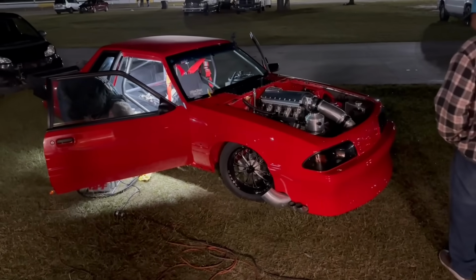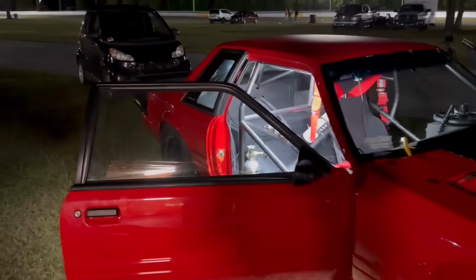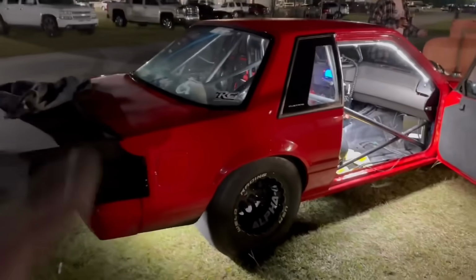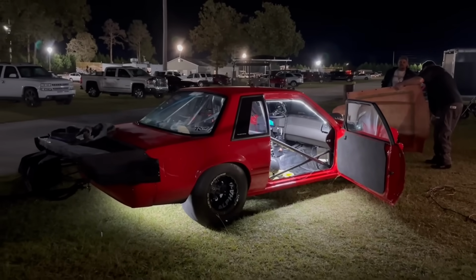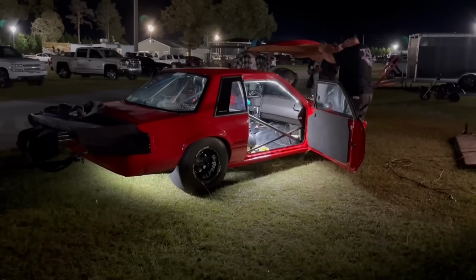All right, guys. Well, we just made our first lick, and that thing went pretty straight, went good. Uncle Mike did a great job on the rear end. Now, something we are not able to monitor at the moment, we don't know how fast it's separating in the back, because the shock travel sensor that was on this car only had like a 6-inch stroke. So that is not enough. Down there, 9-inch stroke, the old ones aren't long enough. So we don't have that on there.